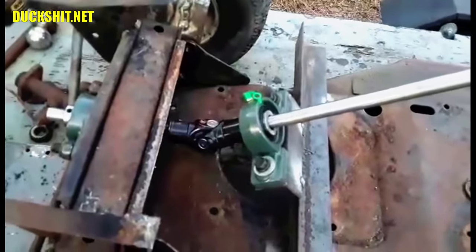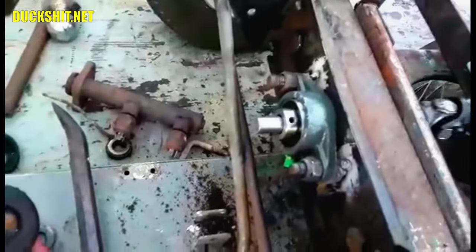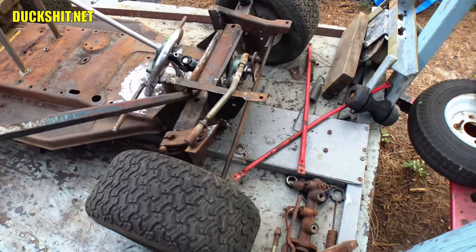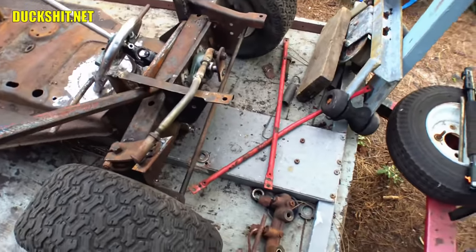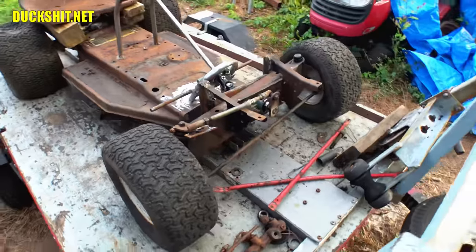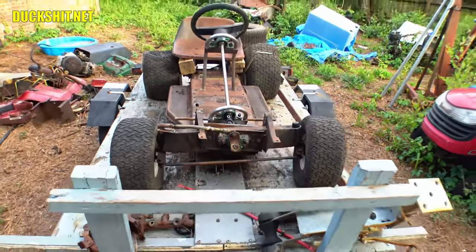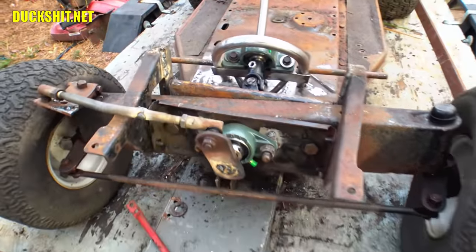So I got to figuring out the steering, which I find very interesting. The steering wheel and steering shaft are from the original mower, but due to the new seating angle, the shaft was just too short and needed a universal joint in it at the correct angle. I chose to push the steering shaft through the front beam because the front beam actually rocks left and right for a very simple suspension. It may be in my best interest to retain this as it helps to keep both rear wheels planted.